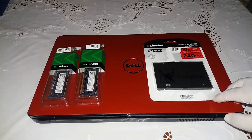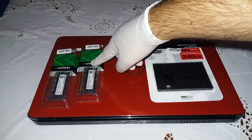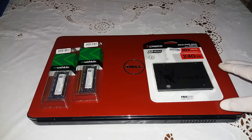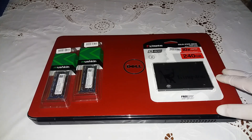The cost for today's upgrade is only 60 euros: 30 for an SSD disk plus another 30 for two RAM memory sticks. This specific machine can accept a maximum of four gigabytes of RAM, because the motherboard refuses to recognize more. So we're going to work with that limit.